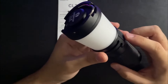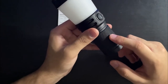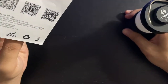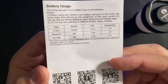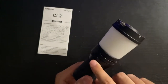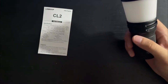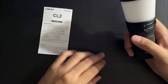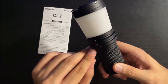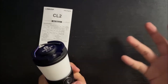What's really cool about this light — which can be very useful especially in a power outage situation — is that it runs on 14500s and double-A alkaline batteries. It also takes NiMH. All versions of double-A work. However, when you charge this light you can only charge the 14500s in the light; you can't charge NiMH through it. Do not mix battery types — all 14500 or all alkaline. This comes with Lumintop 14500 cells that have a built-in micro USB port, and I'd recommend sticking with all the same type rather than mixing with high-output vape cells.